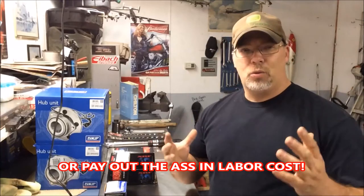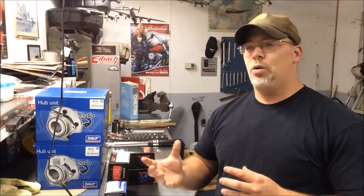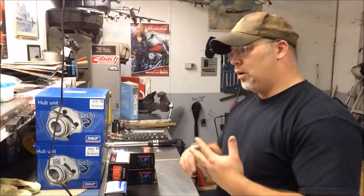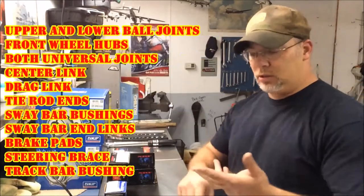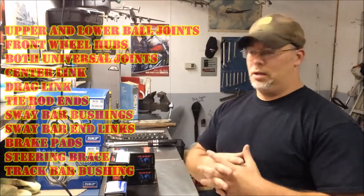I'm going to try and make this video as fast as I can. But if you have a third generation Dodge truck, you either know you need to learn how to fix your front end or you're going to learn very soon. I have a 2003 one ton dually four wheel drive and I'm getting ready to undertake a big job rebuilding the front end. My truck's got 330,000 miles and what the previous owner told me, nothing has ever been replaced. So I'm doing ball joints upper and lower, front hub assemblies, U-joints, the center link, tie rod ends — everything pretty much on the front end. Brake pads — I've got a huge job ahead of me.